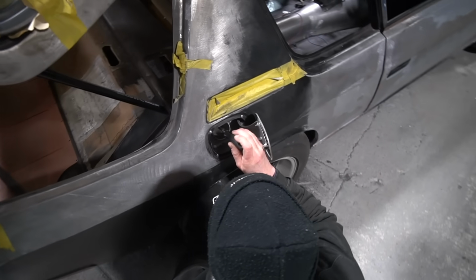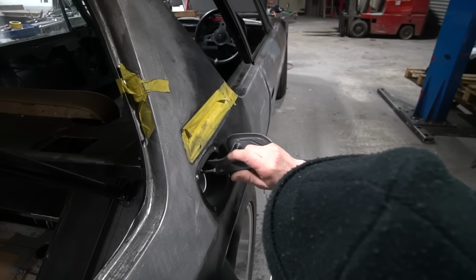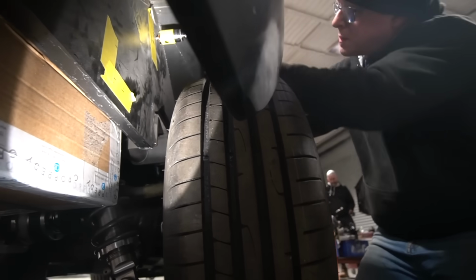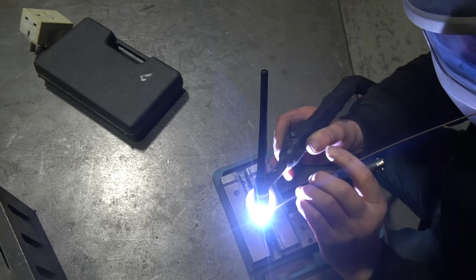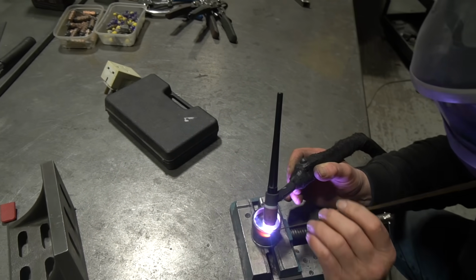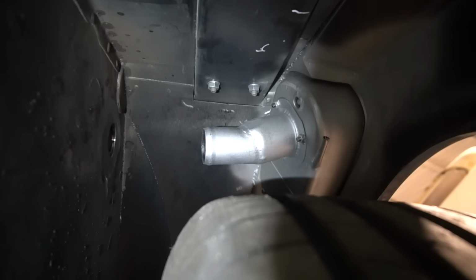It's hard to gesticulate to at the moment. That meant going through the chassis blade. So Stu's basically cut a tube through the chassis blade, lower down than the tube that came inside the boot originally, and then put a little bulkhead inside that to take an AN8 fuel union, half-inch bore, half-inch JIC fuel union that goes through the chassis blade, and then we can have a flexible pipe from the top of the tank screwed to one side of that, and another flexible pipe screwed to the other side of that bulkhead union